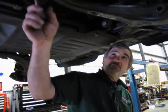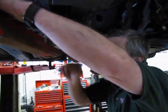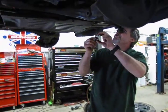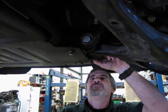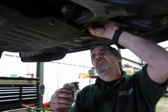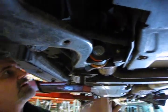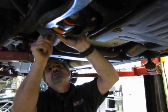So we've got the bolts in place. We're just going to run the nuts on and the cams. Now remember, with the cams, you also had a flat washer. Don't forget that flat washer. You see your cam is pointing up on the bolt, so your cam for the back side is also going to be pointing up. Then your washer, then your nut. Same with the back side. Cam is up. We put our backside cam on in the up position.